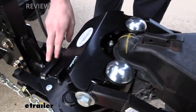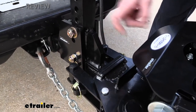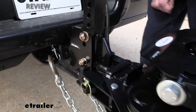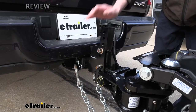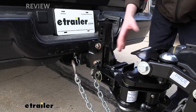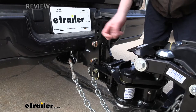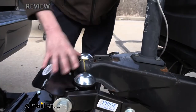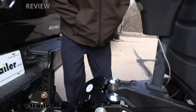The main thing I dislike about the ProPride is that the whole system stays on your trailer and you have to hook up using the stinger that comes included. I find this more difficult to attach than a regular coupler — you definitely want a set of eyes back here, and a backup camera didn't help much because the mechanism is all black and big, disappearing in the camera. Other than that, this is definitely far above the rest for weight distribution and anti-sway. There is a side benefit of the stinger: you get security built in since you need a specialized tool to hook up. I'd recommend putting a lock on your coupler so nobody can uncouple the head mechanism — they'd have to have the proper stinger.